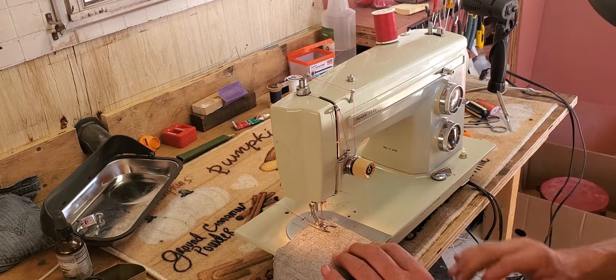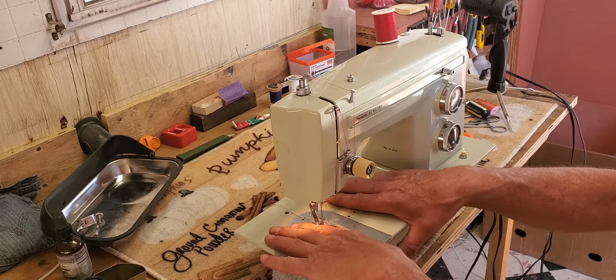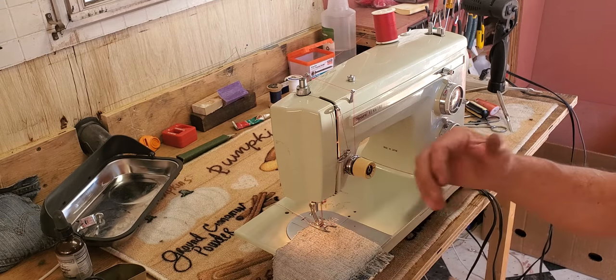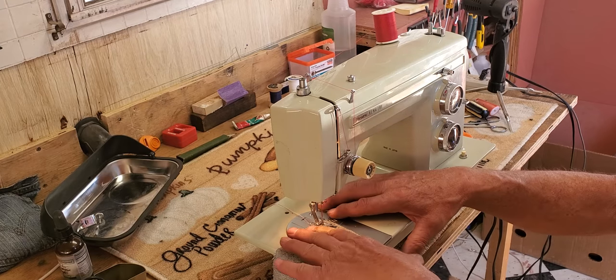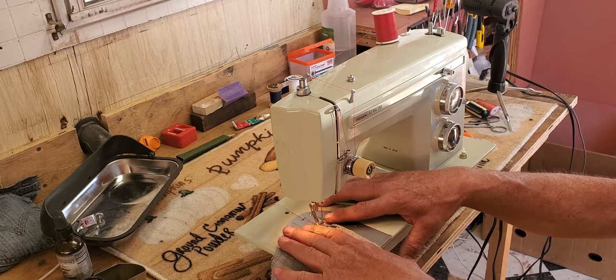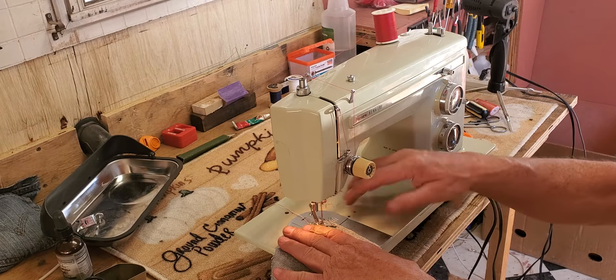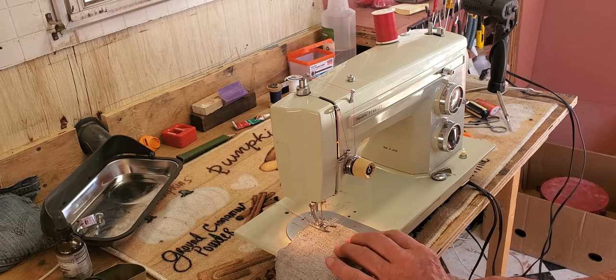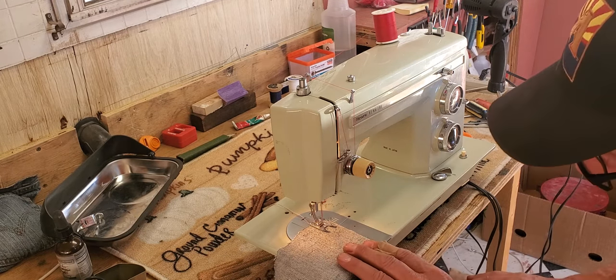So just give it a little gas and don't push or pull on your fabric. Don't try to help the fabric move. Let the feed dogs move it. If you move the fabric and flex the needle, it's going to miss the needle hole, hit the needle plate, explode, and you just don't want that. So guide it, but let the machine move it.